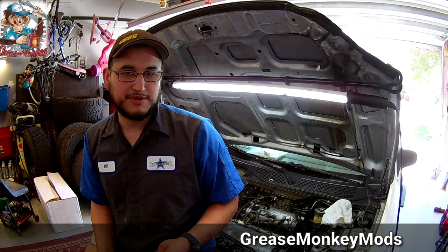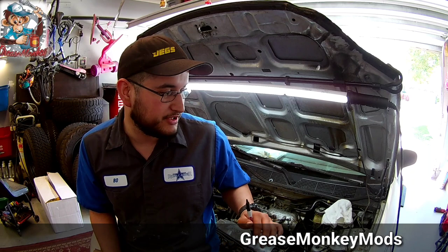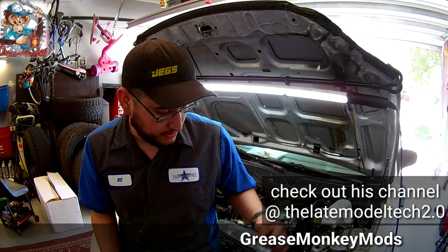Finally gonna install my turbo kit, or what I have of it. I think it's like 90% complete. I've got the turbo, manifold, downpipe, bypass valve, all that good stuff. For the charge pipe, I'm actually gonna build one out of a PVC pipe, because this is a cheap budget build after all. And me and my buddy Donnie from Late Model Tech are gonna be installing the kit in this turd box right here.